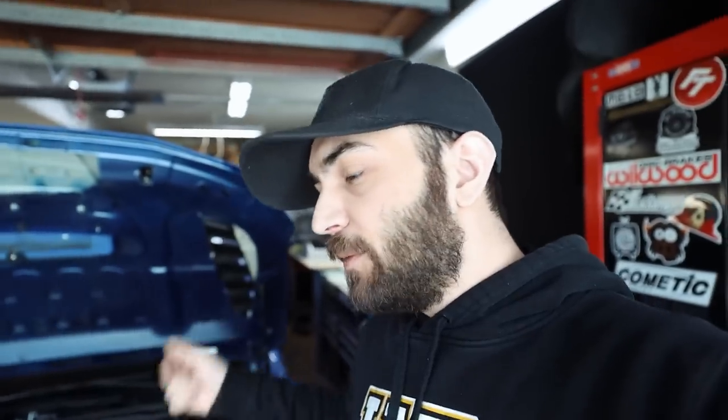We're going to be doing a new radiator shroud on the radiator. We're going to be doing a larger fan. We're going to be using one of our older fans, but we're going to offset it a little bit. We're going to be taking off our cylinder 6 cooling mod. We'll talk about that here in a little bit because I've learned some more things regarding those that could be more detrimental to an engine rather than beneficial. So we'll get into that here in a little bit.